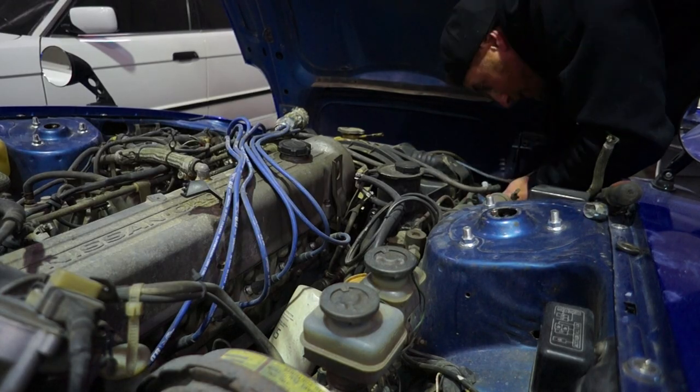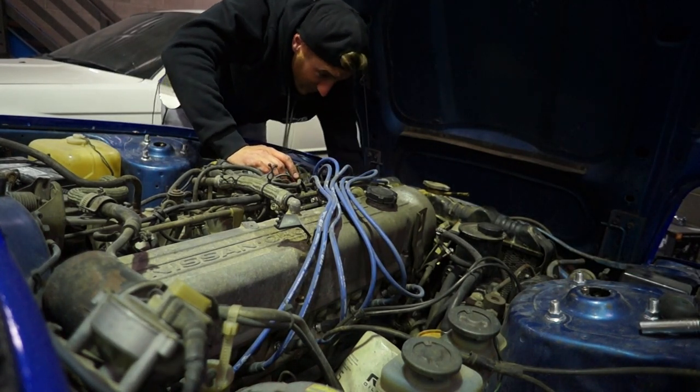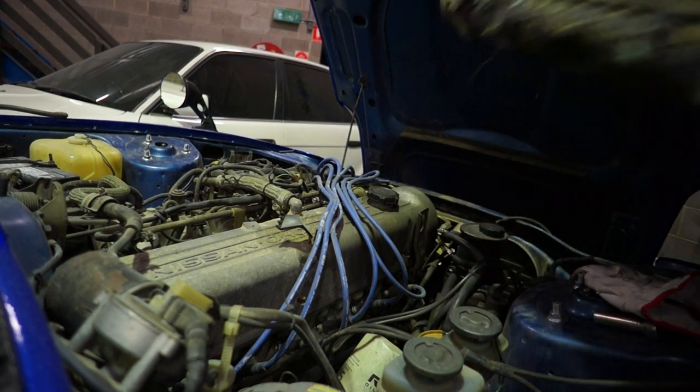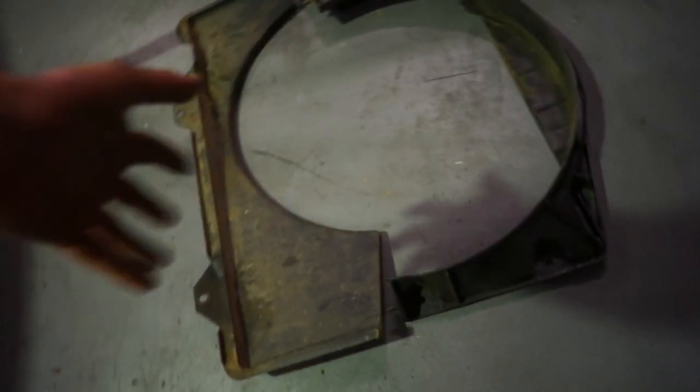Also someone did some artwork on my car, so that's pretty cool. First things first — remove the old radiator. Alrighty, we have the radiator out. Wasn't super hard. The only thing that gave me problems was the bottom hose clamp — it was just kind of seized. But other than that it was a pretty easy process. There are four 12mm bolts to hold the actual radiator in. The shroud is a half shroud so you just undo it and it comes off the top and then off the bottom. Then you can obviously undo the hoses and pull the radiator out.